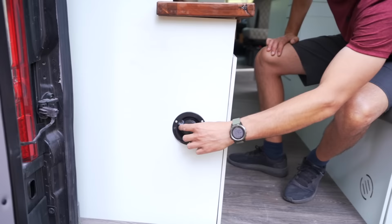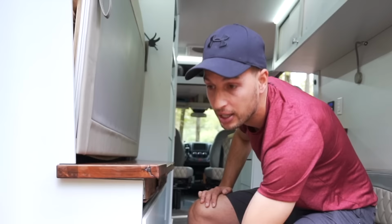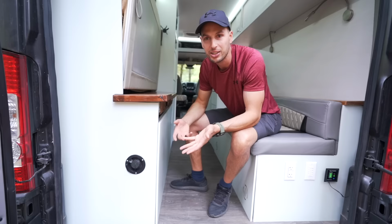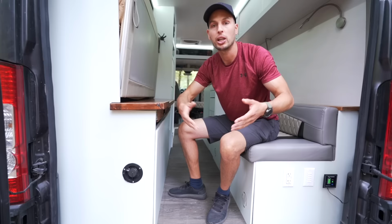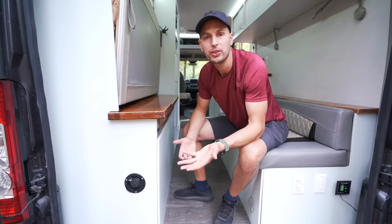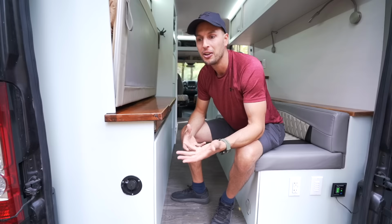This was a new experience. We see people in the community do it often, that they have inlets inside, and we do hate it 100% because it's always messy. There's always some dripping that goes under cabinetry when you fill up the water. In the colder months, you just need to open the first door first to open the second door, so that means all the accumulated heat immediately flies away. You're also showing everybody your personal space when you're getting water. It's just so much easier to have the inlet outside. When you're cutting holes for the roof windows and doing all of these major fit outs, one little hole is nothing extreme.